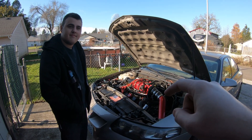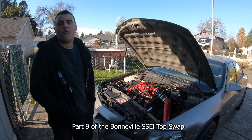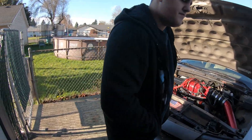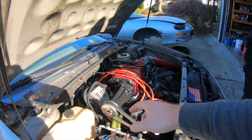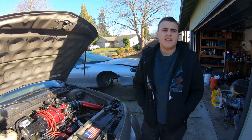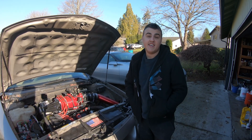If you referenced episode — I think it was like 14, I'll put the correct episode below — at 144 and then 340, you can see that when we put this together, the whole timing and everything. These 3800s have a balance shaft that reduces vibrations. Well, we didn't know, but it needed to be timed specifically, because that balance shaft sprocket has a timing mark that we just didn't see.